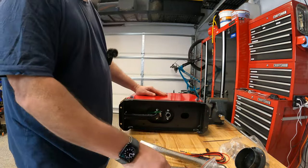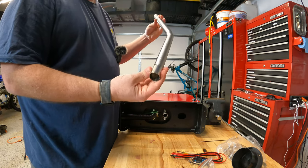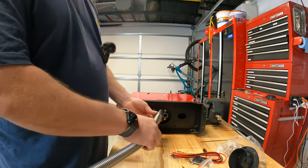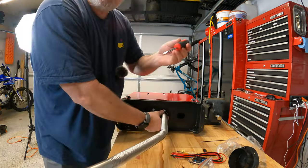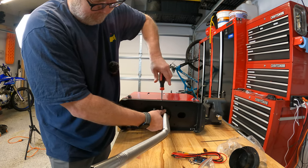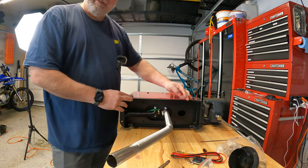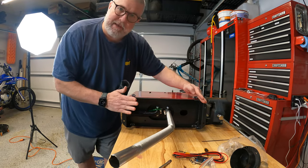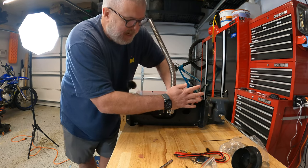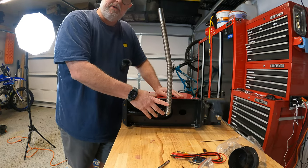This is our exhaust hose — we open it up and we need to bend one side. I usually take the shorter side and put that on the unit. We'll get a hose clamp, put it on, and just like before, take the screwdriver into the little hole here and screw it in place. Our exhaust tube is on, and then we'll put the muffler on. These diesel heaters have feet that come out but they're not very tall, so you usually have to put them on blocks. I bend the exhaust really to the right as far as it will go to get enough clearance.